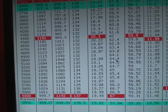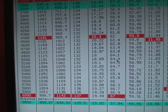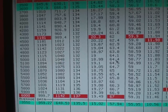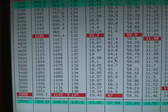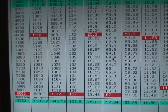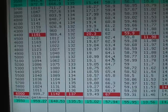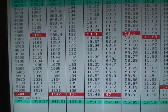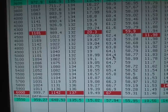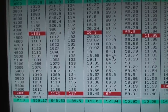At 19 pounds of boost: 1,181 foot-pounds of torque, 1,142 horsepower, and climbing at 6,000 RPM. Good air-fuel ratio, looking nice. It's going in a '32 — it's going to be a wild ride. The car's name is Psycho, and this thing is definitely Psycho. There's another 16 pounds of boost available if he wants it, but really, I don't think he'll ever need it.